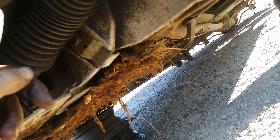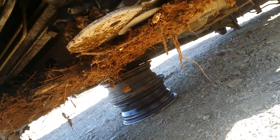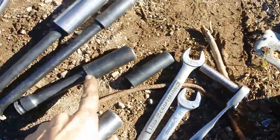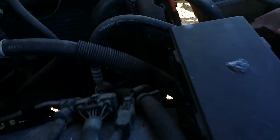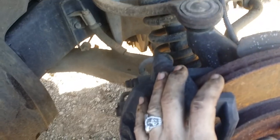Next: 21 millimeter - that's when you start taking out these four big bolts. Pro tip, and this is a serious pro tip - listen carefully: do the driver's side first. Do not try the passenger side first. Do the driver's side first - boom, boom - then the back side. Sometimes getting the tool head in there requires an extension. The passenger side is frequently a little bit harder because the bolt holes on that side are actually oblong in the subframe, so your tool will frequently hit the stud when dropping. With aluminum control arms it goes easier; with steel control arms it's a much bigger pain.